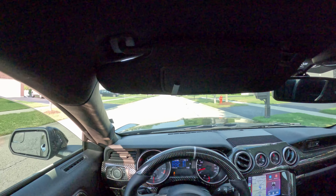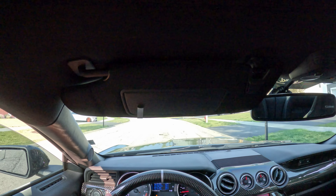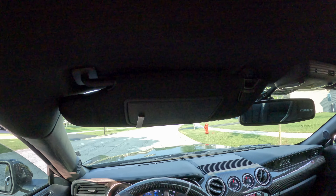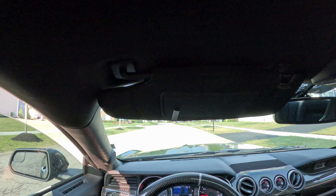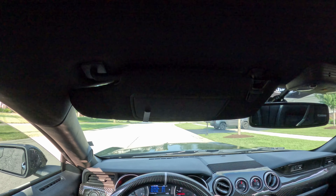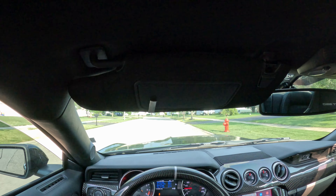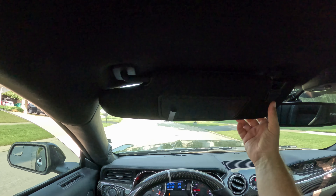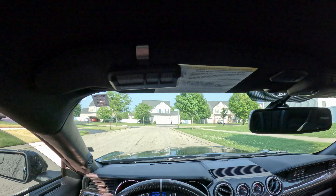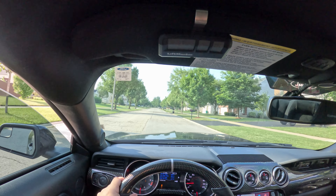Taking a little drive in the 2018 Shelby GT350. Consider it a full bolt-on — it's got Stainless Works headers, there are definitely cats on it. It has a resonator delete with an X-pipe, a JLT cold air intake, and a Solar Performance throttle body, which I believe is just the stock throttle body bored out larger. It's got the stock intake manifold, not ported, the 350 manifold. Sitting on Signature SV302s with an MGW short throw.